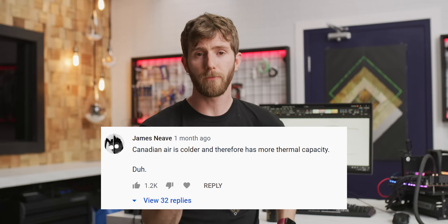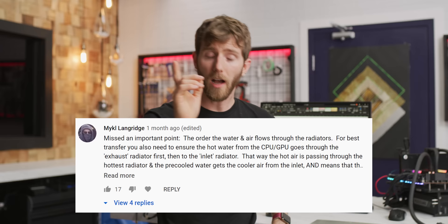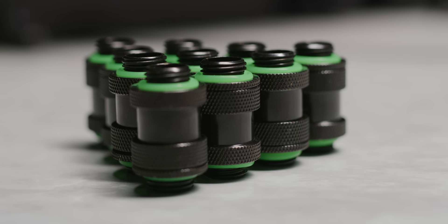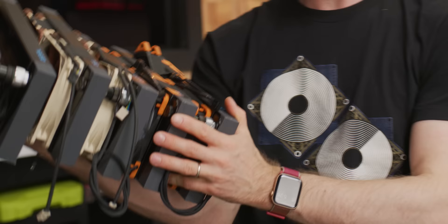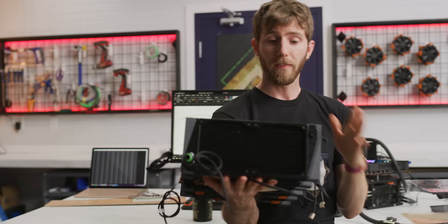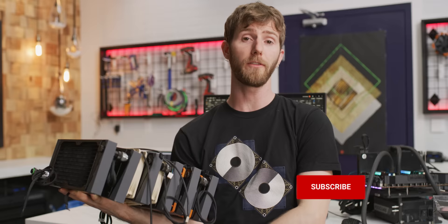While some of your complaints can be chalked up to not paying enough attention to the video, others seemed to have some merit - you guys still weren't satisfied. So I greenlit a project to go full crazy on a test rig to isolate the variables we had kind of hand-waved away. We reached out to Alpha Cool for seven of their 240mm cross-flow rads and thermistor-type temperature probes. Performance PC also threw some low-profile fittings our way, and with some fabrication and 3D-printed end caps, a wind tunnel was slapped together from clear acrylic.